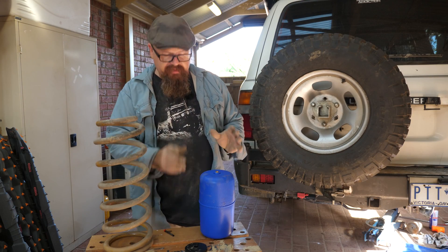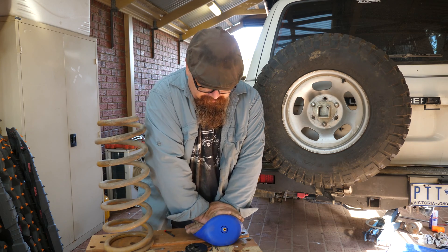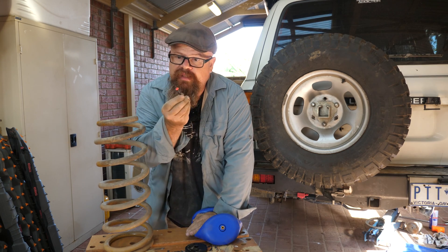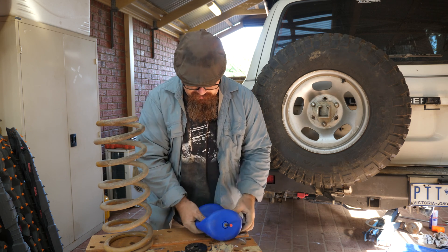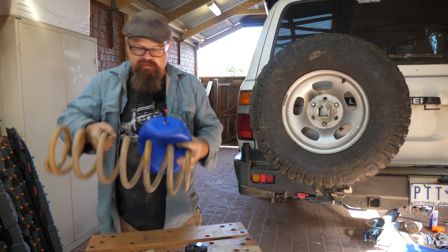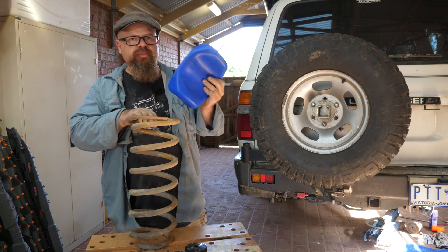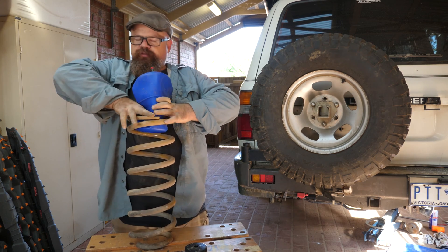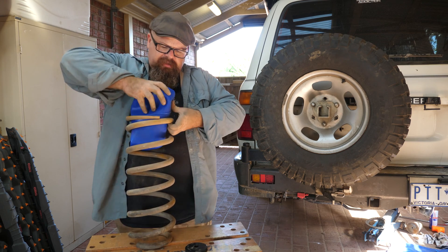Now comes time to put the airbag in — there's a bit of a trick to these. What you can do is get a little bit of air out, get a short piece of tube, put a bung in the end. Once you've pulled a bit of air out, just gently insert it into the end there — that'll keep it a little bit flatter. Then get your spring, remembering this is the top surface, so you need your nipple pointing up. Insert the bag — it's a little bit easier. Keep going until it's all the way in.